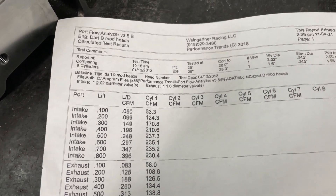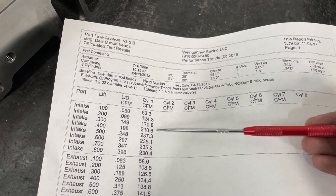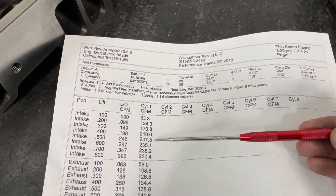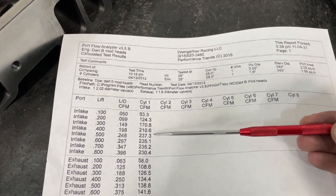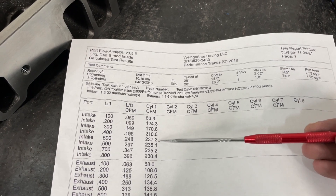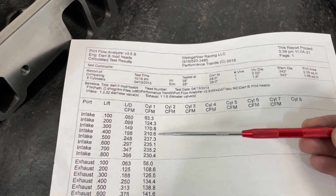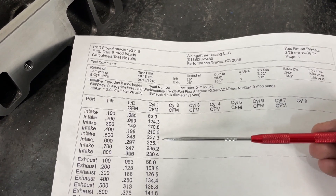The intake's not all that bad. The 400 number is the one I care most about — it's not bad: 211 CFM. A stock Vortec, by the way, is around 212-213. However, looking at the later numbers, 237 at lift 0.500 — that's where it's at peak — then 235, and it kind of drops off. That's better than a stock Vortec from my bench; the stock Vortec is usually about 232. So this is about 5 CFM better there, about a CFM worse at 400, and about the same otherwise. For the most part, it's almost as good as a stock Vortec. Almost.